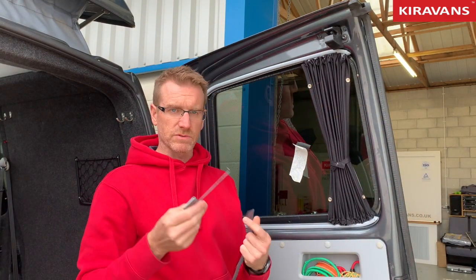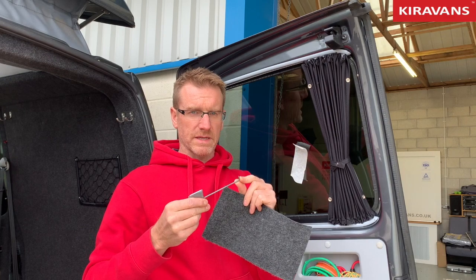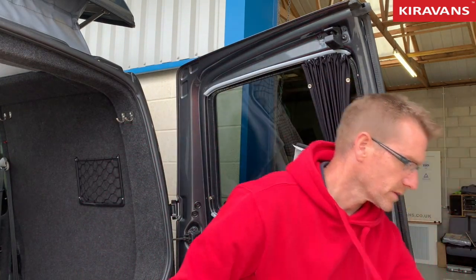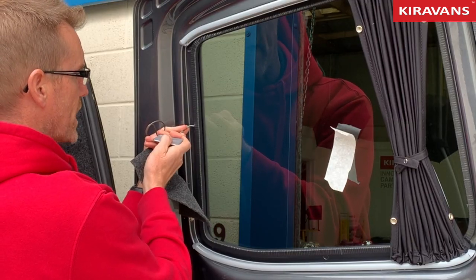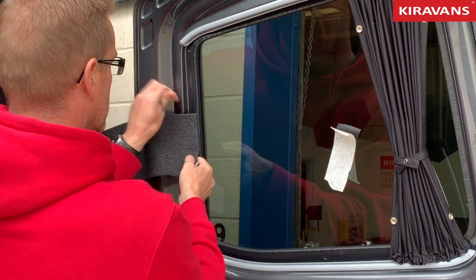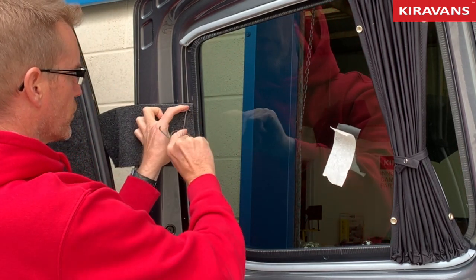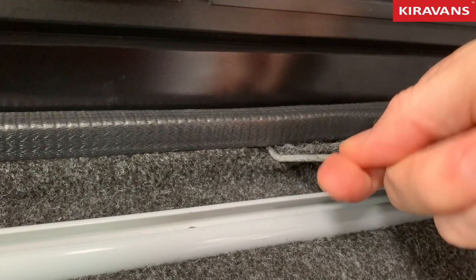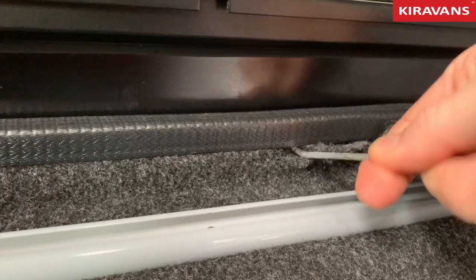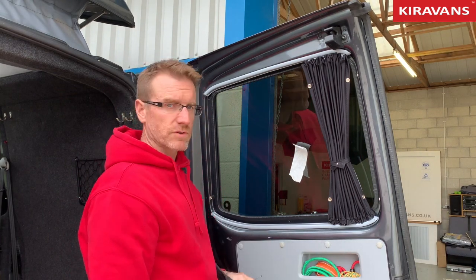What I did was make myself a little wire tool with a bent end — like a little hook. I've actually got two of them, which means I can use one to prise that rubber back a little bit. You prise the rubber back and with the other one you start to run the carpet in behind that rubber trim. You end up with just a couple of millimetres tucked in behind your knock-on edge.